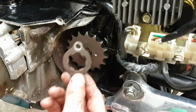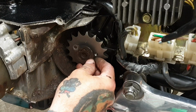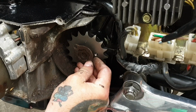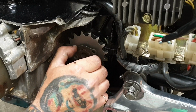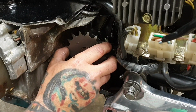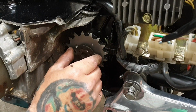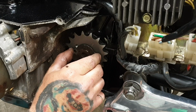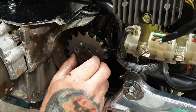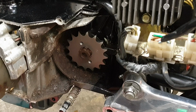There, and then it's a case again of putting the lock washer back on, nuts, and do the reverse. I'll wedge the handle in here just to do it up. So that now has got to sit. Once you can get it on, you really are in the way. Alright, turn it. Right, so I'm going to have to turn the sprocket until everything lines up. So if we go a full turn and try, no, I've got to get it on a flat like that. So I'm going to spend a few minutes spinning this round. I'll bring you back once we're ready to nut it up.